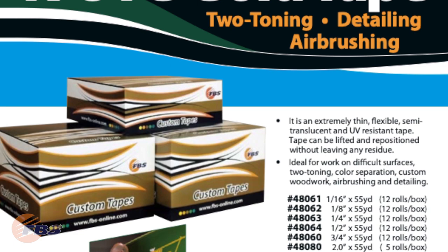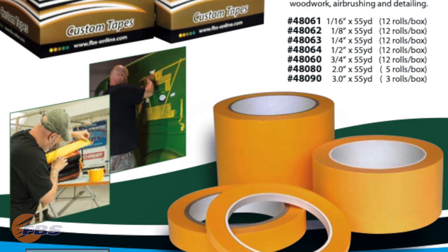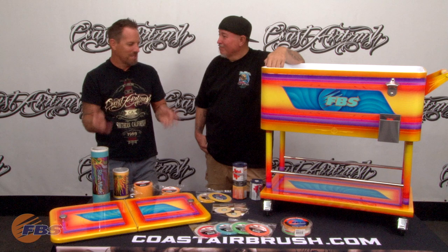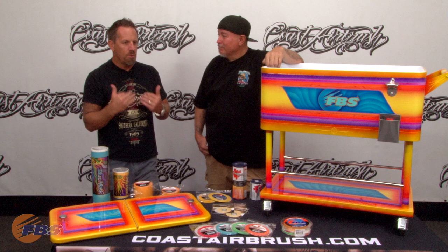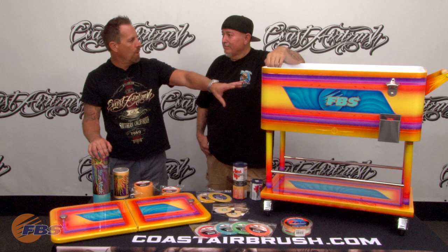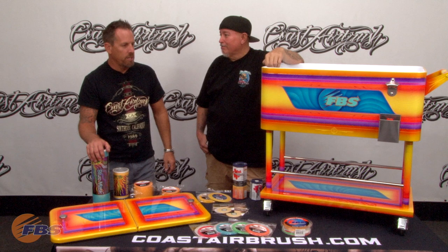As well as the gold tape, this comes in a variety of sizes from FBS, and it's just a phenomenal product. This is the one I keep around my shop and kind of hide from people because I want every size of my rolls — it's my go-to every time I'm doing something. The thickness of this particular product is so thin that it doesn't like to build up a tape edge either. That's a really big attribute we look for in a custom paint job, because there are times we're not going to want a tape edge that we'd have to pinstripe over. So that eliminates a lot of the time having that huge ridge and trying to bury it with clear coat.